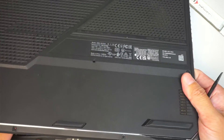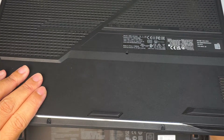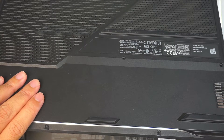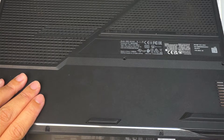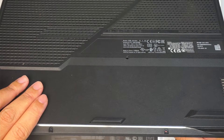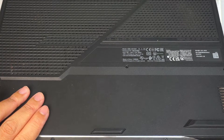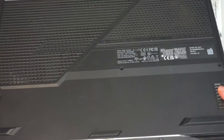At this point, please do not pull the back cover off like I did. It looks like there is a lighting strip connected by a flex cable at the bottom. Everything is still connected — do not pull off the back cover; just gently leave it open. The next step is to disconnect the flex cable.